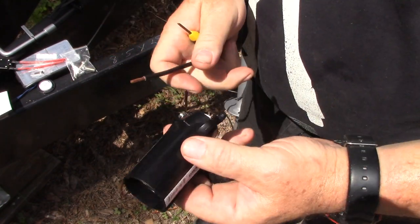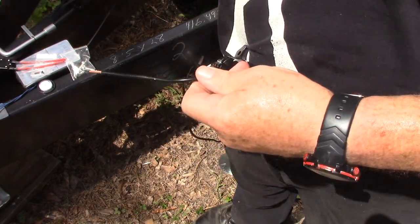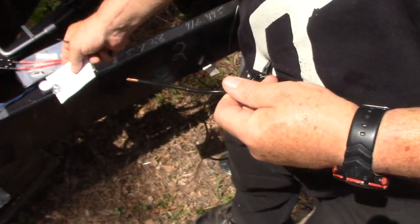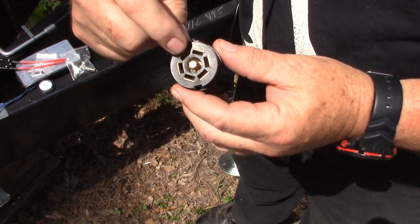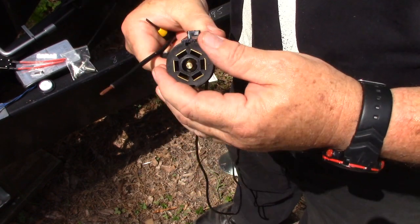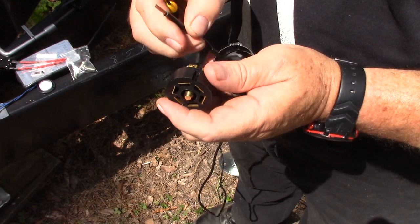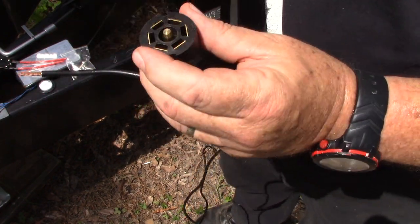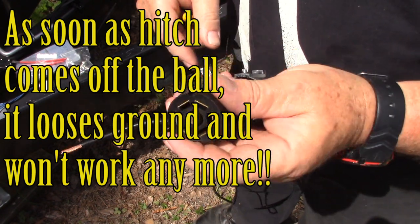So this particular jack just comes with one wire — that's the hot wire. They're using the ground from the jack through these washers, expecting them to go through the paint and make contact with the frame. So there's just one wire, and I need to hook it up to my 7-pin. This terminal right here is going to be hot on my truck, so I'm going to hook this hot wire to this connector, run it through and attach it to the pin. I'm thinking when the hitch is on the ball, that should provide ground.